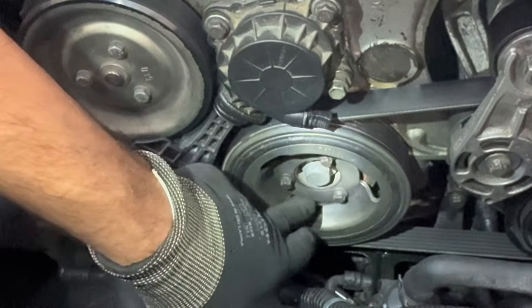This is the main area where we can understand if the oil is leaking or not. When your car is still, you might see some oil on the harmonic balancer — just look into it and you can see oil. There are only light oil spills, but during hard acceleration there might be more oil pushing out. I had cleaned all these parts during the seal change and ran only about 30 miles — and this is what happened.